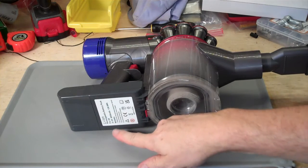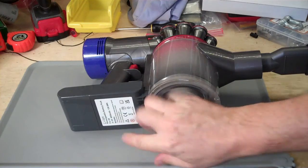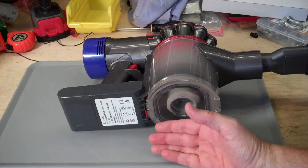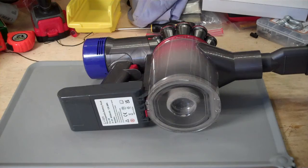Now obviously 70 is less than the 129 watt hour faceplate claim on this battery, so there can't possibly be a larger battery than 70 watt hours in there, and it's probably closer to 60-65 watt hours given the inefficiencies of charging. So it's been on there for 9 hours and 29 minutes, the lights are turned off, it's definitely done charging. So this replacement battery says it is 6,000 milliamp hours or 6 amp hours, and they claim 129.6 watt hours. And yet when I recharged it, the charger took 70 watt hours to recharge it. So they're lying about that.